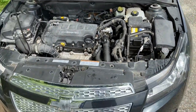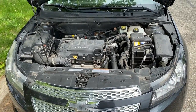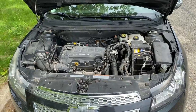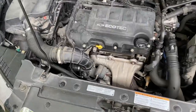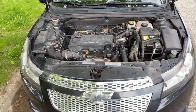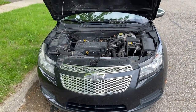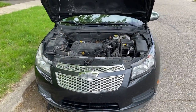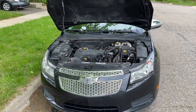Hose is secured. Go ahead and re-secure your negative terminal to the battery, then properly fill your coolant system with fluid. There is a right way and a wrong way — there's a link above for step-by-step guidance. We're back from our test drive and good news: no leaks, which is great. Hopefully this helps, and hopefully you don't have a sensor that breaks off inside the radiator. Do us a favor — click the thumbs up below, subscribe to the channel, and ring your YouTube bell. Thanks again for watching.